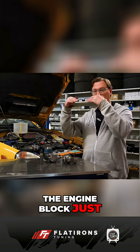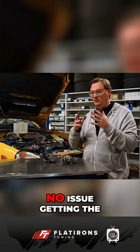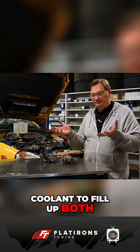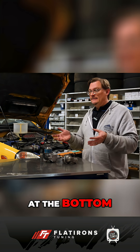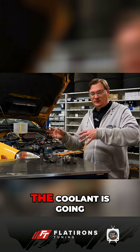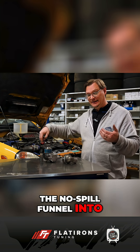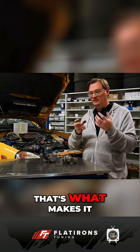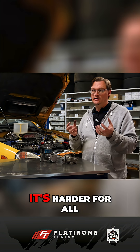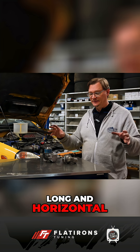It can go to the radiator. The engine block just fills up, and then the thermostat is right at the top, and there's really no issue getting the coolant to fill up both the radiator and the engine. But with the Subarus, because the thermostat is at the bottom, as you're filling things up, coolant is going to go into the radiator and you're going to fill it up through the funnel into the engine too, but that barrier between the two pockets is what makes it a little bit more complicated. That's where it's harder for all of the air to come out, plus the boxer engine being long and horizontal.